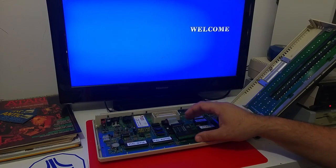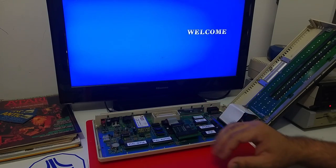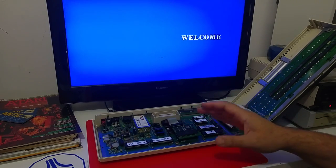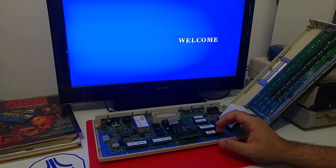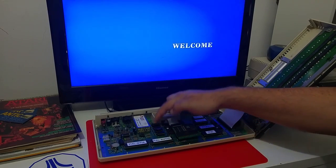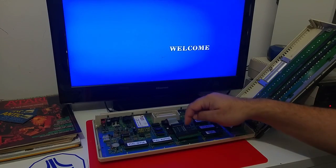It's a piggyback board and does not require any soldering — just take out the processor, assuming your computer already comes with sockets on it. Remove the processor, remove U18 and the MMU, and just plug in this board.